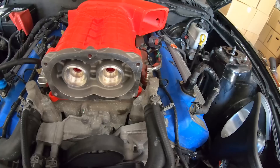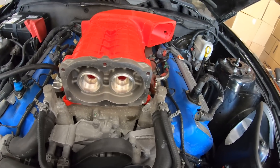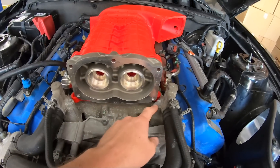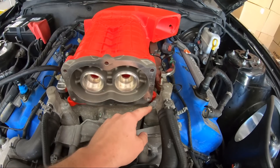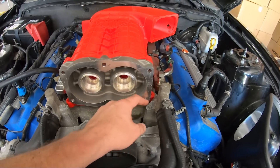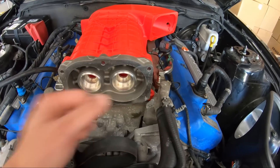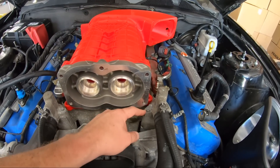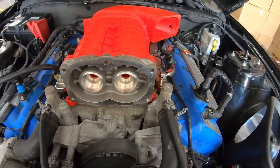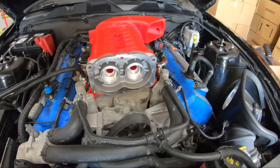I even have a rotor plate and an old nose drive that I'm going to slip on there to see what a complete supercharger would look like. To install the Gen 3 on a GT500, there is a little modification required right here — we actually supply a special tool that goes on the end of a drill that mills that down. You use a vacuum to keep the mess to a minimum, and then you can put our low-profile bolt in there, or just put the stock bolt back in there if you don't have the low-profile bolt.